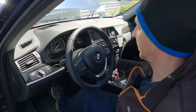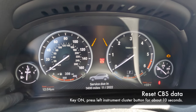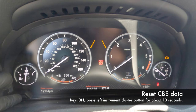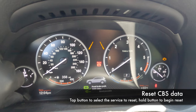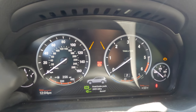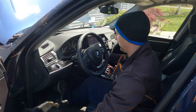You also need to reset your brake service light. Press the start/stop button one time — all the instrument cluster lights come on. Press and hold the left instrument cluster button. The services that are due will show at the bottom. Front brakes are showing green at 3,400 miles with reset possible. Press and hold again — it says reset. Press and hold again. Now it says 90,000 miles — the reset is complete.